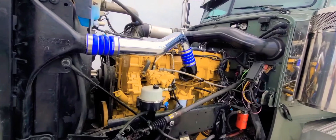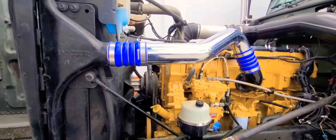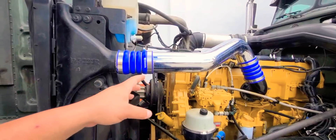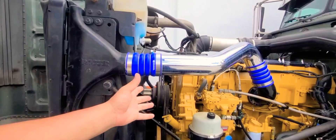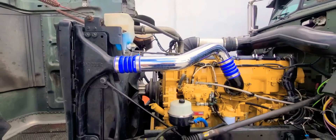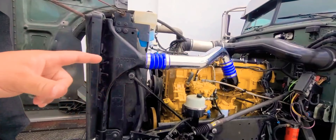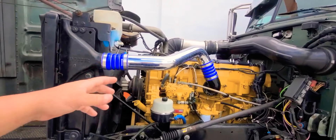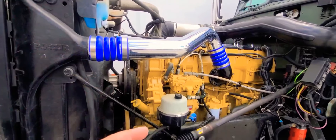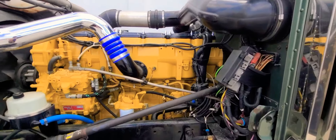The silicone that I used is actually meant for head gaskets — it's meant for oil pans and stuff like that. So it's a really good silicone, it also resists temperature — it's actually meant for that. I also added Teflon on the bolt plus that silicone for extra security. Once it goes in there and dries up and cures, I should be good to go without any issues at all.